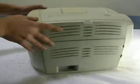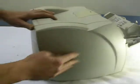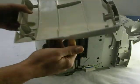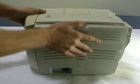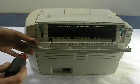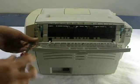Let's get started. First thing I like to do is open up the toner access cover, and let's remove the connectivity cover. You can see it just has one simple little push area on the plastic. And let's work from the back of the machine. I like to work today with a good magnetized Phillips screwdriver. You're going to see 3 screws on the left. You can remove all 3 of these.